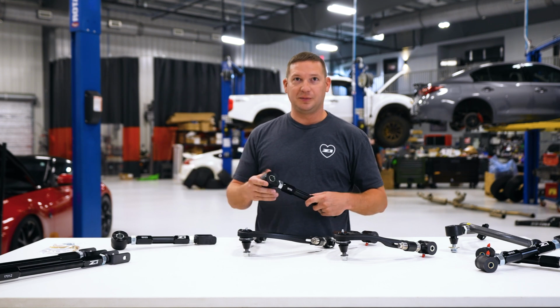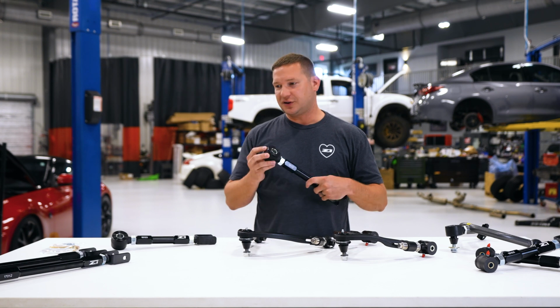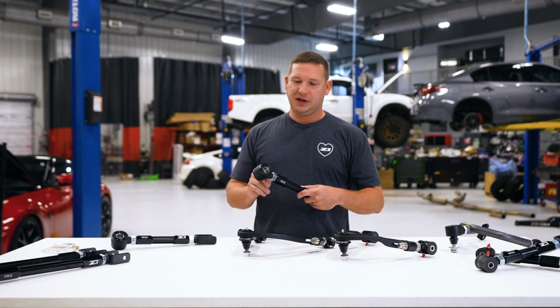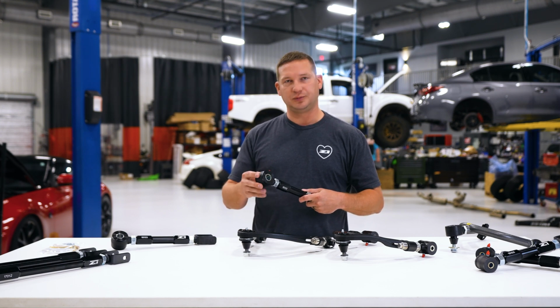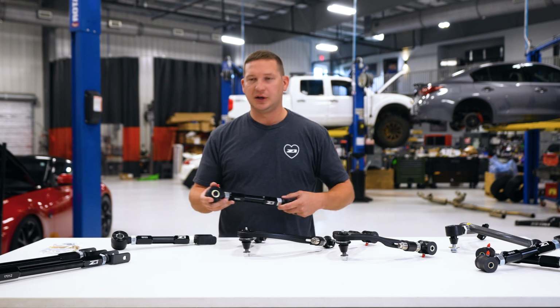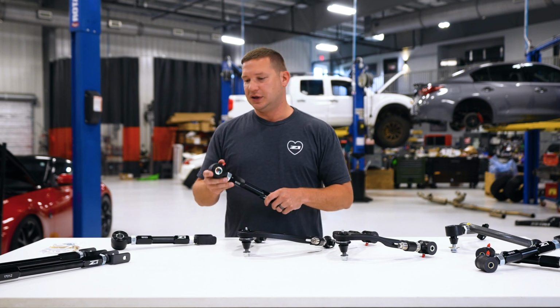We throw away fewer of them because they all come in tolerance, which is nice. And they hold it for longer. They're actually stronger. No worry about salt water or things getting in behind a weld if there was a porous spot or something like that that could maybe haunt you years later. We haven't ever seen that on a set of the previous arms, but it's one of those things as a manufacturer you'd worry about.